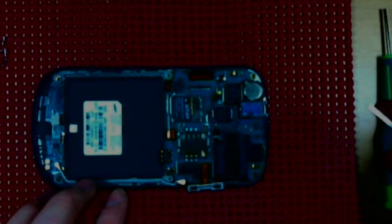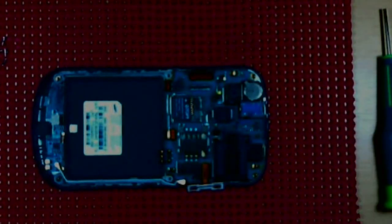There's one more little connector — a ZIF clip here. Note that you don't lift the brown part, but you lift the black part and that pops up. Then you can pull out the speaker module.